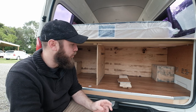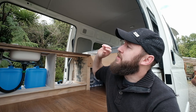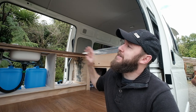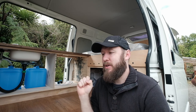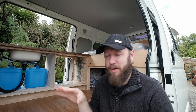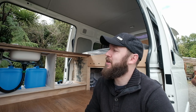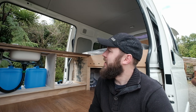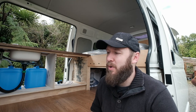Once the floor was framed out, I insulated all the walls and ceiling with woollen insulation. I chose wool rather than other types because I was stuffing it into every gap and didn't know exactly where it was going. I didn't want it to go mouldy, and I didn't want it to catch fire around all the cables and electronics — I didn't want anything to short out and burn the van down. The whole lot is fully insulated.